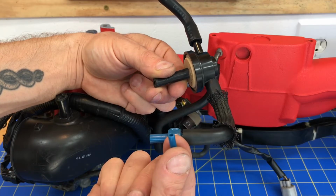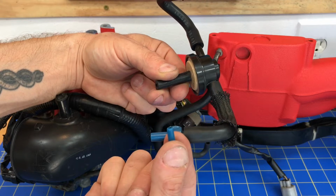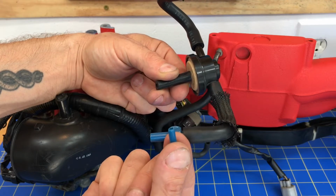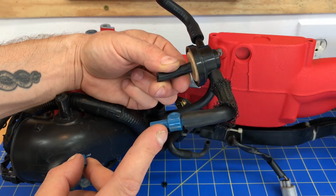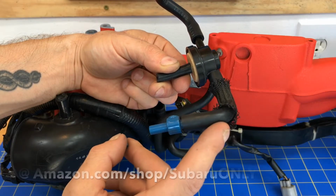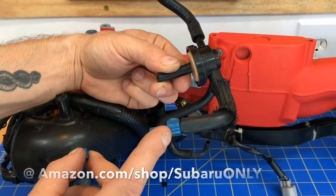these, and it's pretty common because these plastic parts and these rubber hoses actually see a lot of heat cycling. That causes them to get hard and brittle over time, so it's pretty common to have to replace all these parts. And when you order a new one of these little 3-way T-fittings, it actually comes with all the little molded hoses as well. So I'm going to go ahead and replace all these little molded hoses and that 3-way T-fitting.